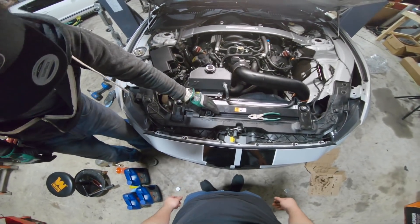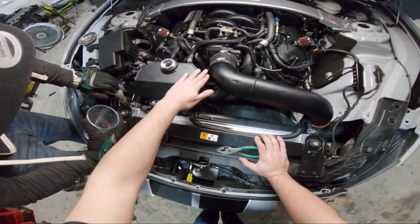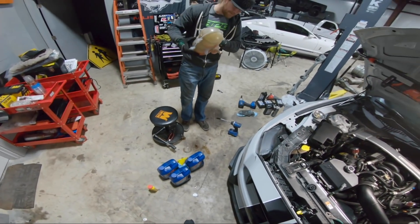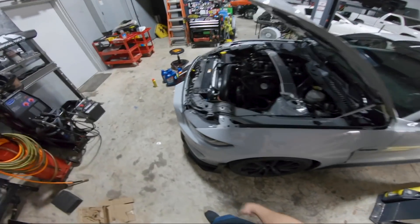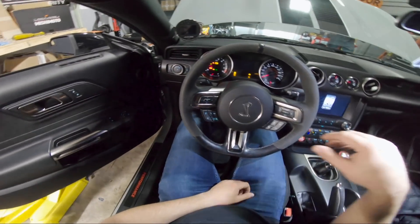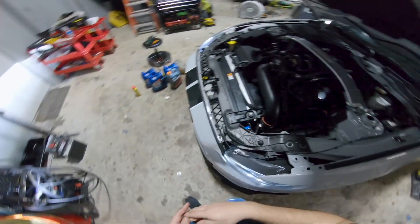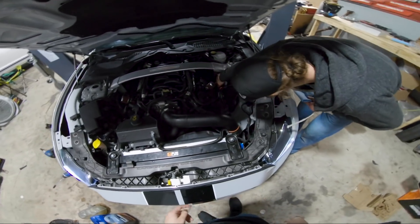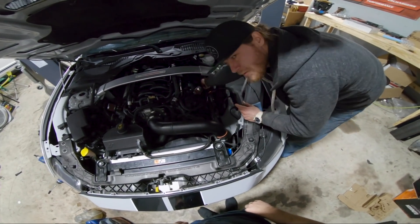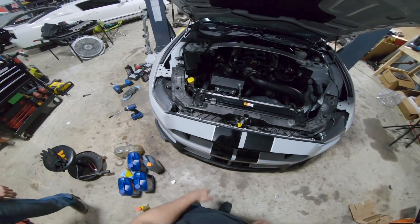The install is super simple. Put that on there and slide it down in place. Cool thing about this expansion tank is that even though it is completely black, on the side right here you've got this little tube which is very handy for being able to see your coolant level so you don't have to take the cap off. Alright, we are pretty much good to go now. I'm going to go ahead and give the engine a start, let it get up to temp and idle. It's probably going to smoke because we just put the new turbo blankets on. I let the car sit running for just a minute and I go ahead and check the oil level just to be 100% sure — right to the top, sweet.